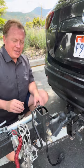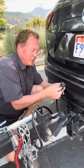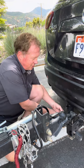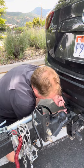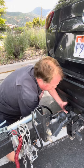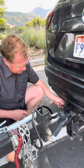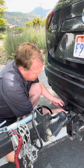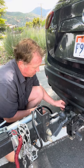For the electrical connection, you'll notice a ridge that lines up with a ridge on your vehicle at 12 o'clock — most vehicles are aligned that way for the electrical connector. If you're using a four-prong, use the adapter into the 7-pin connector and then plug in your four-prong.